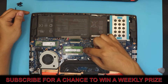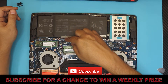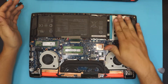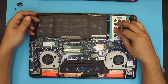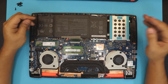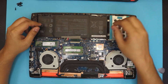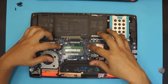Right in front of you, that's the RAM right there. Some people say you have to disconnect the battery to remove the RAM — you don't need to, as long as the system is off. Just make sure you touch the caddy on the hard drive to ground yourself; that will be enough. Don't rub your foot on the carpet or anything like that. You can buy one of those grounding wrist straps, but I usually never use them.